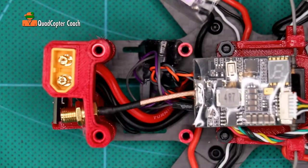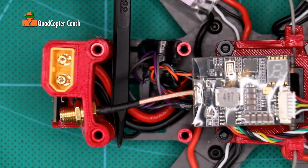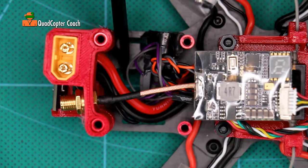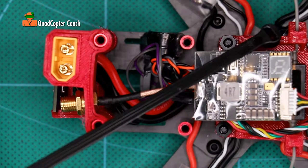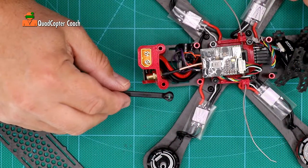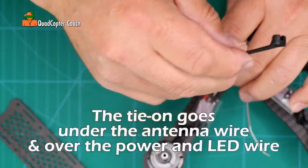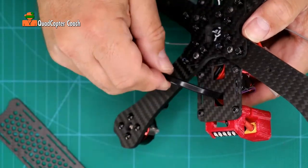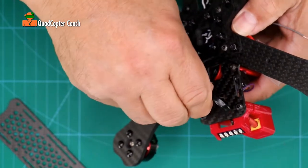I have something very important to stress: your power lead gets a lot of tension, so it's a good idea to use a tie-down to secure it so it doesn't get pulled out. We're going to do that now before we attach the top plate because it's much easier. These wires for the LED and the power we can just bind together — there are two holes here, and we're going to run this tie-down through both of them and secure it. I like to hide the knuckle of the tie-down by putting it on the inside, taking it over the power wires and through the hole in the bottom, then into the other hole.